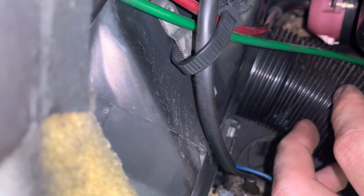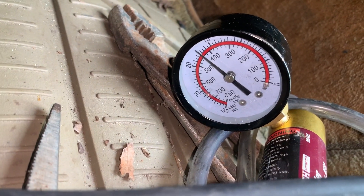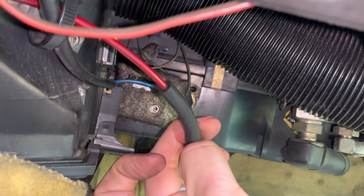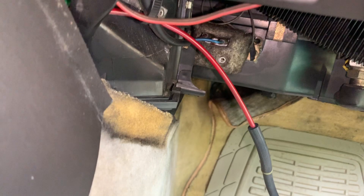Fixing that one probably involves pulling the dash and I do not want to do that right now. You might be able to pull the glove box and do the other one. For this one we'll do the same thing — pull the hose off and test just the line. This one's holding; pull my finger off and it goes down. So those two lines are in good shape, but we've got a problem with the line going to the floor vent. We'll take the vacuum tester over to the parts car and test those two diaphragms.